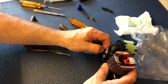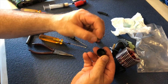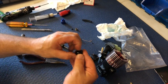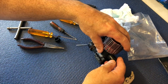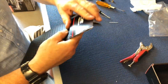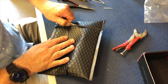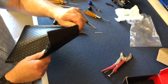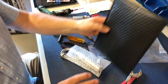A little tip: when you take the caps off keep them in your bag because they're useful — you don't want any dirt going in. Put your nipple cap in there, keeps everything together, and put it in the bag so when you service your engine you take it apart. Then we go on to the X1 exhaust and tune pipe. I'm using the medium manifold. The X1 is quite a handy pipe because you haven't got a rubber seal joining, so you won't get any air pressure leakages — on other pipes you have to check that the rubber seal's not leaking causing uneven pressure.